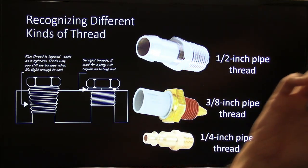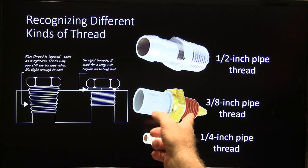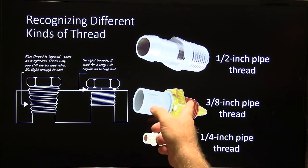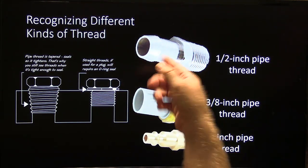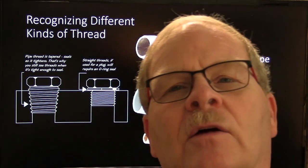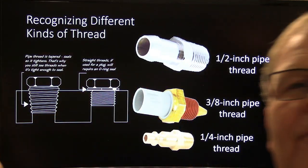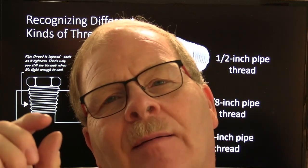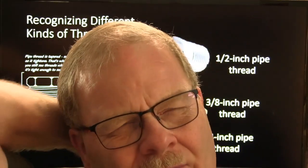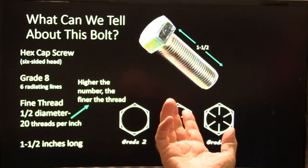There are various different ways that coolant sensors mount, but a lot of times you'll see one mounted with 3/8 pipe thread. This right here is where your heater hose goes in. The fitting you're probably most familiar with is the little nipple that goes on your impact wrench — it's quarter inch pipe thread. If you're looking at quarter inch, you're talking inside diameter on schedule 80 pipe, but the outside of those threads is as big as a 3/8 bolt. That confuses people who don't know how threads work.